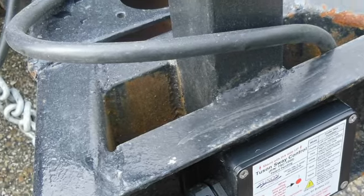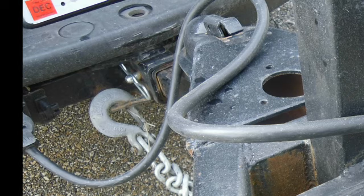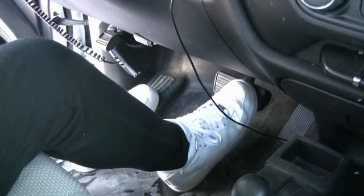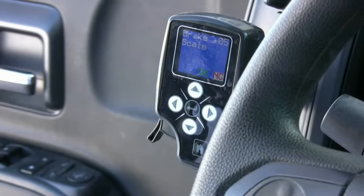Now we are ready to power up the TSC. We have hitched the trailer to the tow vehicle and also connected the 7-way trailer connector. The TSC requires a trailer brake signal on the blue wire to wake up. Start the tow vehicle and step on the brake pedal or activate the manual override lever on the trailer brake controller. The TSC's status light will come on and display a red and green light for the first couple of seconds and then display a slightly flickering green light if the system diagnostics determine that no fault exists.